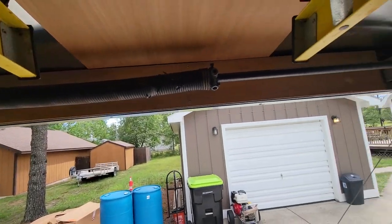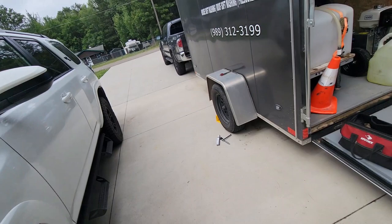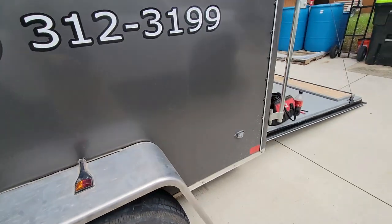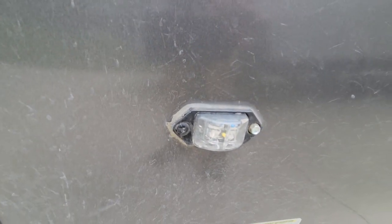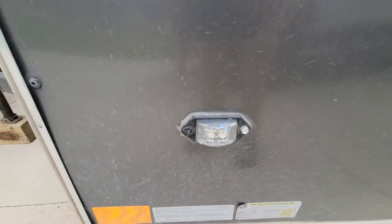This is just simple stuff. Check your wiring lights — plug in your lights, turn them on, and walk around the whole place. Make sure all your lights are working. If they're not, usually it's something as simple as a bad ground. Notice here we've got black screws in that one — that's how it comes. I've had to replace that screw in that one, and that one had a bad ground in it, so I had to re-caulk that corner of it. But I got it fixed.